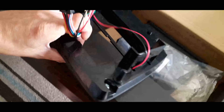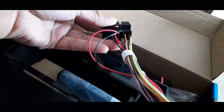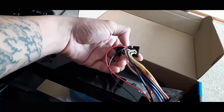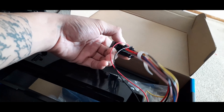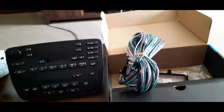Here is your power wire. On the older dash kits — the older models — where this airbag plug is, you're going to have to put it in the plug-in yourself, so it would just be a dangling wire. Here's an older dash kit right here, and you see how the wires are just hanging — you're going to have to do that manually by yourself. So there's the dash kit with the power harness, and here is your little sleeve that goes under it if you have a single-din. And here is the harness itself that goes into the brain of the radio — or the stock amplifier.